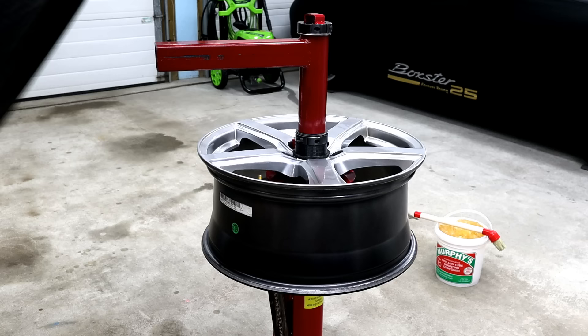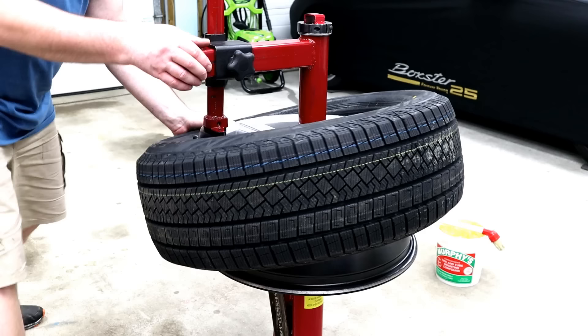When we took the tire off we were pulling the bead over the top of the duck beak or head, and this side was riding underneath. We want to go opposite here — we want the bead over top and underneath the duck head. Just make sure you don't get your fingers trapped in here. It does take a little bit of force and you just want to make sure that you're holding that bead underneath that duck beak as you go around. And that's it — easy breezy.